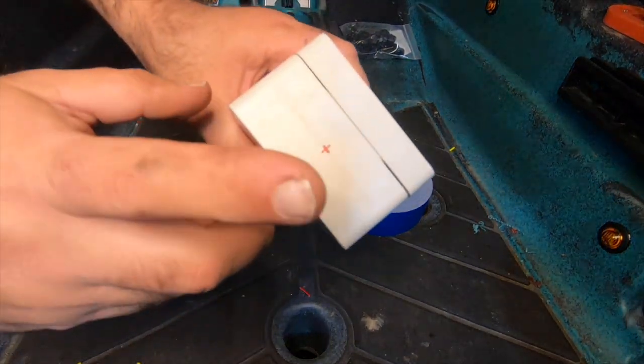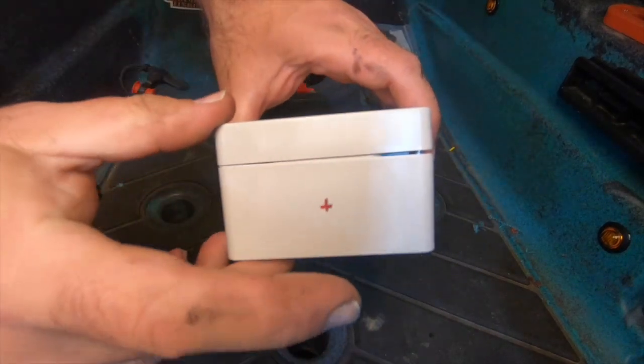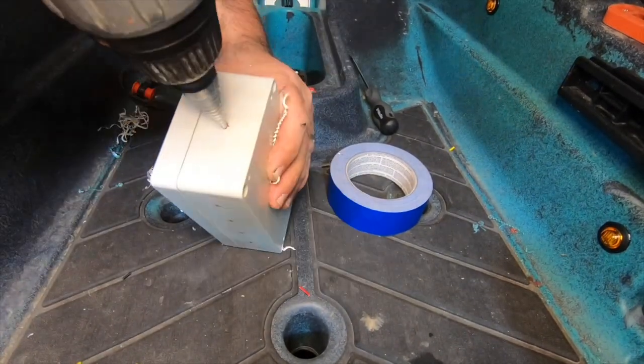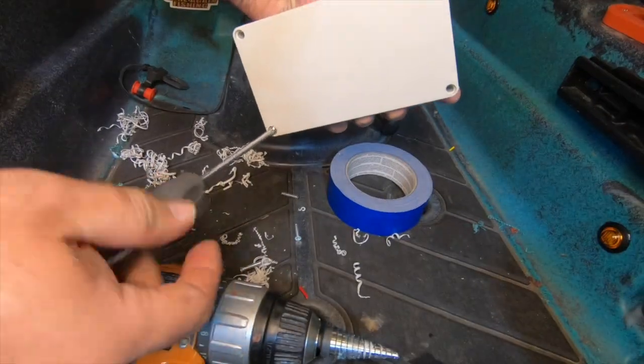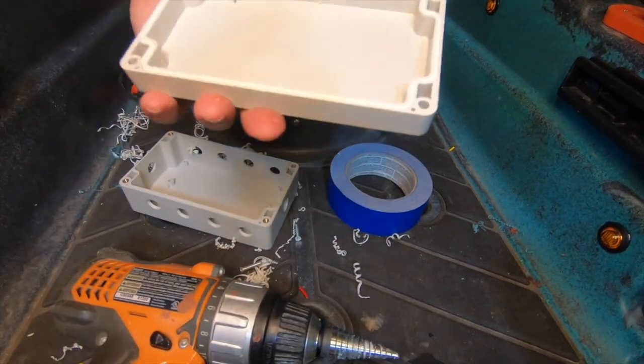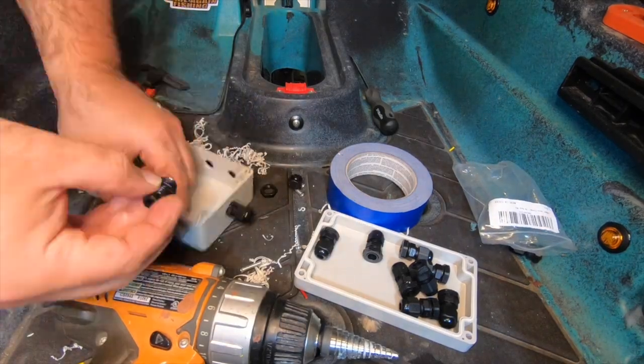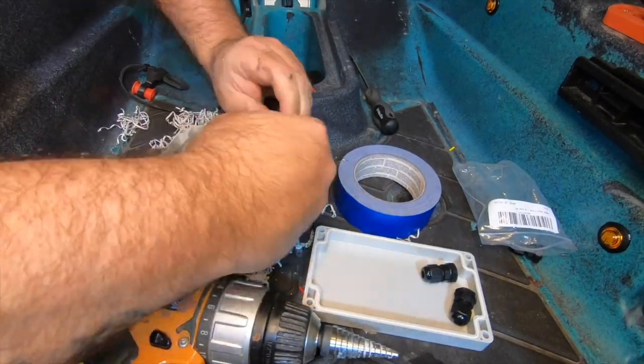We're in the home stretch. Everything has been fished and all connections have been made on the hard part of the boat. The next step is to drill holes in a box — you can put away your heat gun and crimpers. Lesson learned from previous builds: measure out and cut your holes in the box first. We're doing 10 holes — one for the line from the primary switch box, eight for the individual lights, and one spare for future expansion. Keep the lid on while you drill; these boxes can crack under pressure, and the lid keeps them square. After drilling, pop off the lid and check your ring gasket to ensure it's installed correctly. Each hole gets its own waterproof gland — there should be about 20 in a pack from the previous build, and you'll use 10 here.